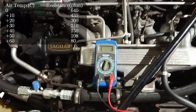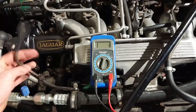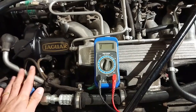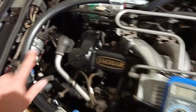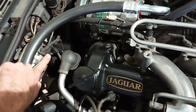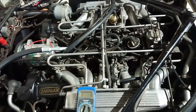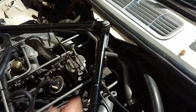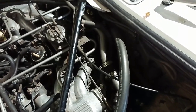So now, if you've tested both of those sensors and made sure the cables are nice and clean, you know that at least this part of the system is working fine — those are really the main sensors. Of course there are other places to check: the MAP sensor connection must be very clean, make sure all the earth points are very clean underneath the car, and make sure all the positive posts on both sides are also very clean.